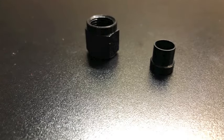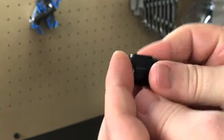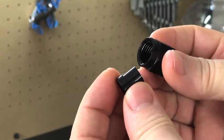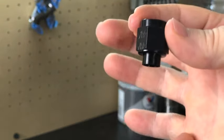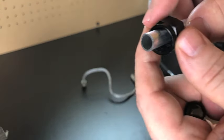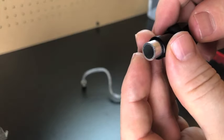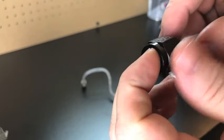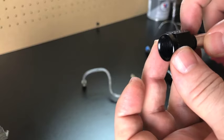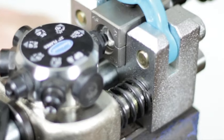Now for the 37-degree angle flare fitting — this one has two parts. The inner sleeve has a tapered side which goes in with the threaded side of the fitting to the front. So here's how it all works: you'll take the fitting and put it on the line with the threaded side forward, then take the sleeve and put that on with the tapered side towards the fitting. The lip is what catches the back side of the fitting and the flared side of the tube. Now you have to flare the line — I used the Eastwood flaring tool and will do a review on my next video.